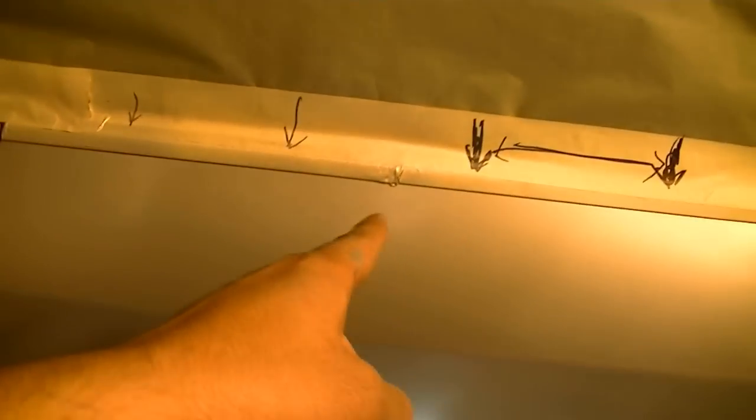Okay, so things are going good as planned, besides this little area. This is where I started painting, and I guess my hand wasn't moving fast enough, so right there when I started spraying, and right around there when I started spraying there, you can see there's more paint there, so it's more shiny because of the pearls in the paint. So what I'm going to do is just go over that area a couple of times, try to even that out, then blend this top part a little bit up to here, so that it blends in. But the rest of it is good, so I'm just going to blend the rest of it as planned, and then that area is just going to get a lot of extra attention. Hopefully I can hide that somehow.